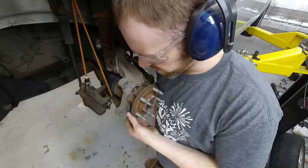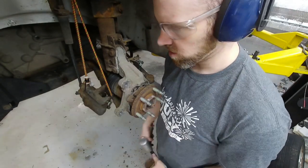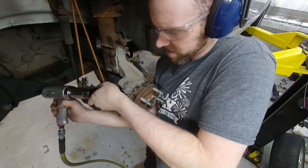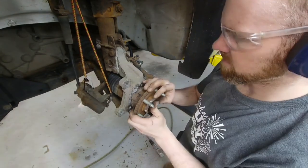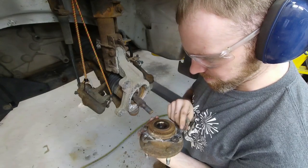You can see how I've twisted this wheel bearing — it's still tight. Now I'm going to go from this angle with the air hammer to get it to free up a little bit. And you can see it's obviously loose and it came out of there.